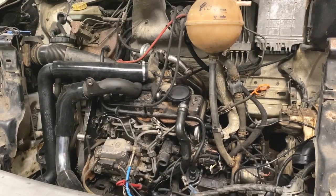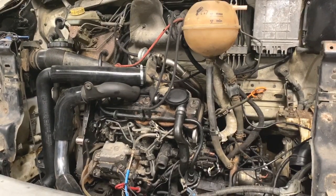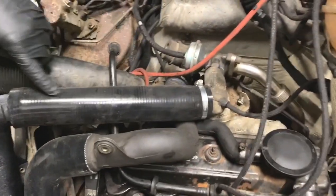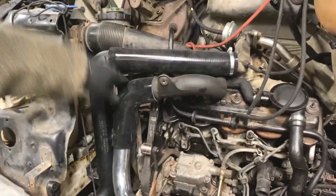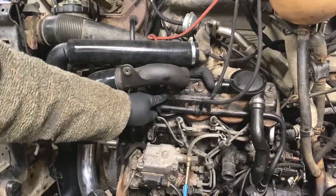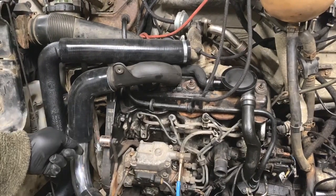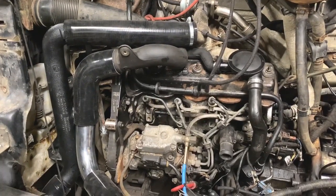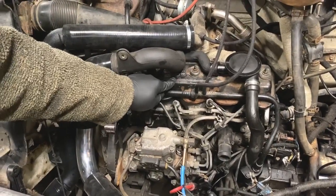Just in the update: I'm up at the unit today. We were going to go to work but it started to rain quite heavily, so we popped up here to get a couple of bits and I thought I might as well do a couple of little jobs on the van conversion. We came up yesterday and worked out how all the pipework can go to the intercooler — the intercooler is right down there. Now I've connected all that and know how I want it, I've got to take all that off and then do the rocker cover gasket. I've got the new one just behind me. I've also got to do the cam belt cover and torque the tensioner up on that, but I haven't got the torque wrench with me so I can't do that right now. I can do the rocker cover, so that's what I'm going to do.